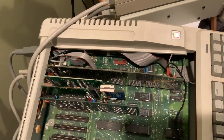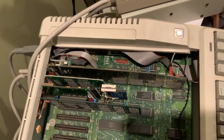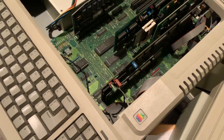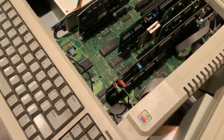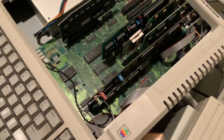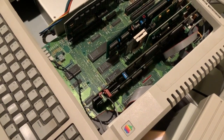Now, I believe it's a monochrome out or a CGA compatible display. Also notice that there is a daughter board for RAM chips. It comes with 768K of RAM, which gives you 640K for the IBM PC side. That RAM is also usable under ProDOS, so you can have a 768K RAM disk.